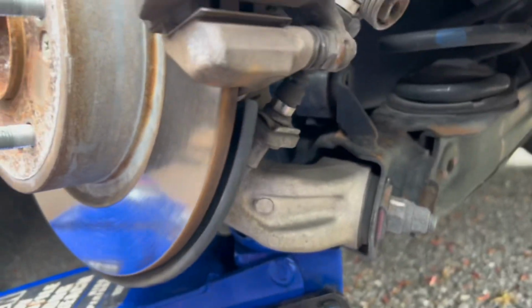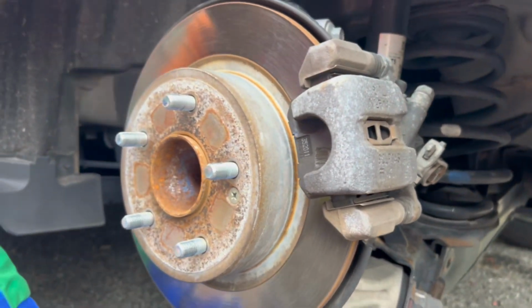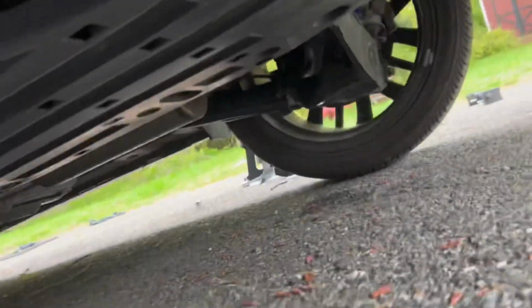From here, we're gonna go under to the sway bar housing. Now, most people are gonna tell you that you need to just take apart the end links, which are gonna be those purple things back there. And if you're able to do that, by all means, but we ran into some issues with those and we're gonna be taking a different route. So we're going to actually be going underneath and hitting on the frame those two screws right there.